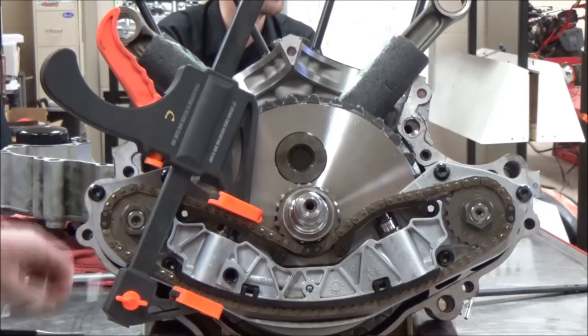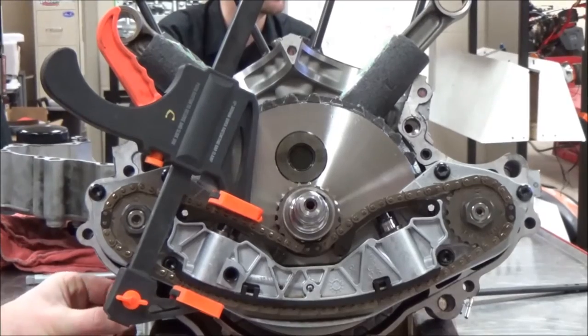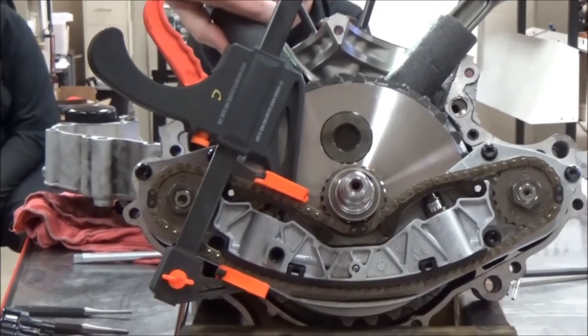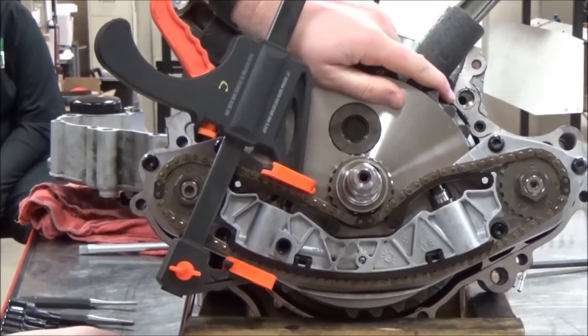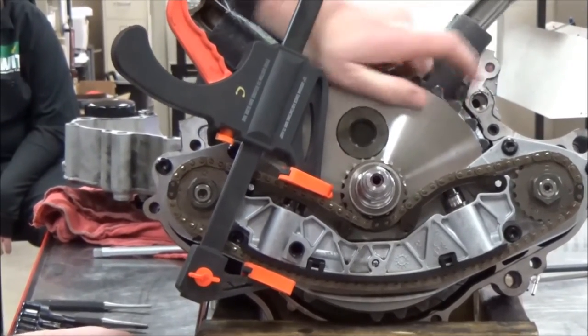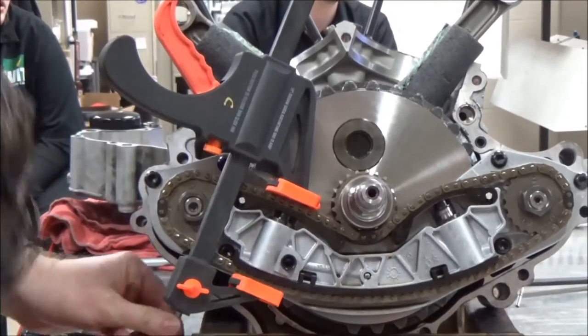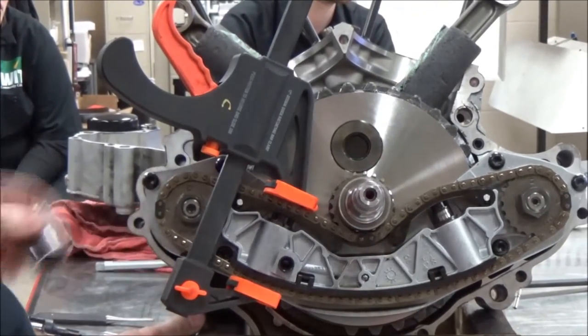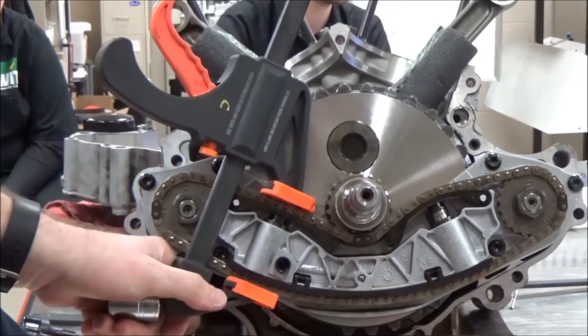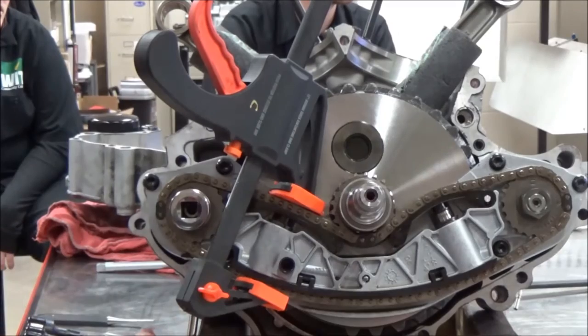The other thing we're doing is putting this pin holder down in here. The crankshaft moved on me a little bit and I have to line it up. Then I can go ahead and get my socket on here, and what I'm doing is stopping that balancer from rotating.